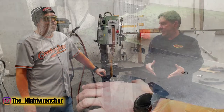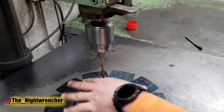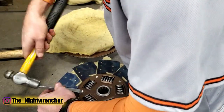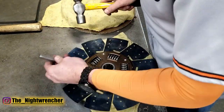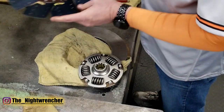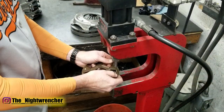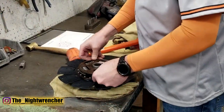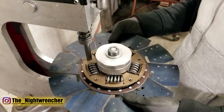The first step in building the disc is we're going to have to change out the hub because of the special transmission combination that you're using. We've got Jason here. What we're going to do is use this template to help us line up the rivets and drill out the rivets that hold the existing hub in place so that we can swap it for the new one that matches your transmission. Swapping the hubs in the clutch disc sounds complicated, but it's really not too bad, especially when you have all the right tools. We're going to swap out the springs from the original hub into the new hub and then rivet it all together.